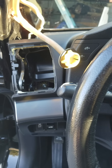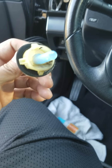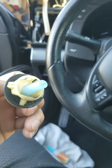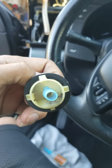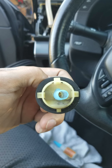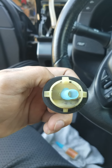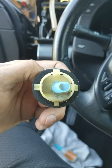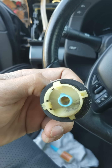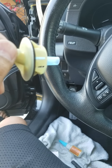I'm gonna show you how to fix it and put everything back together so that next time it doesn't leak when it rains really hard. What I did was I added a tube to the front end of it, so when the water comes out it just spills out the tube instead of running to the side. You can see all that dirt that runs to the side — that's where the water is going and it's coming into the car. But once you do this to the drain it should automatically spill out behind the tube and won't go into your firewall anymore — the water will just drip down that way.